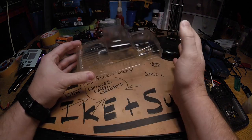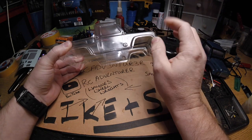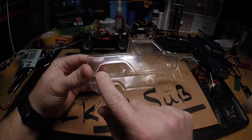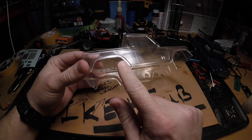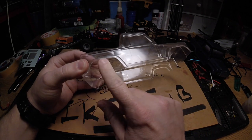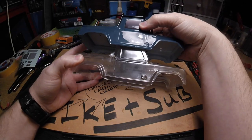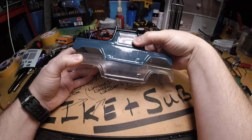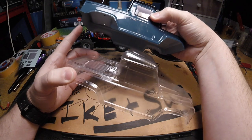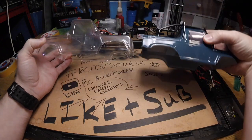Preparations: cut it out carefully, and any little trimming you want to do you can do with a Dremel — but keep it very, very slow on the speed. There's a telltale line in these arches, so I just need to go around them a little bit more with the Dremel. I need to put a smaller diameter sanding disc on just to keep them tidy, and then you can compare the cutting to the original. I've trimmed mine quite a bit because I've modified the bumper mounts.